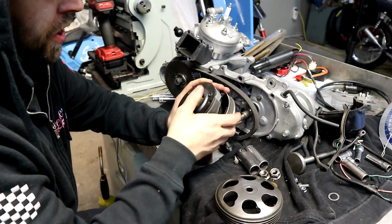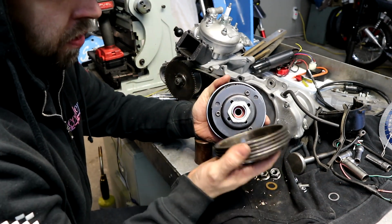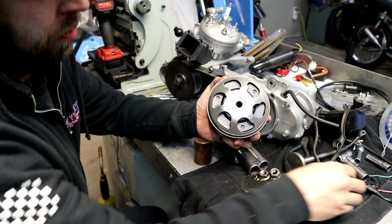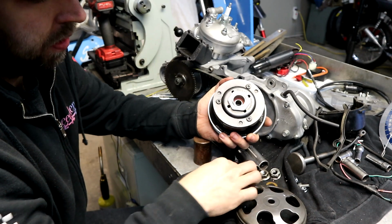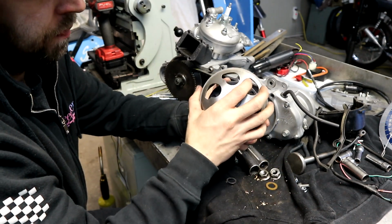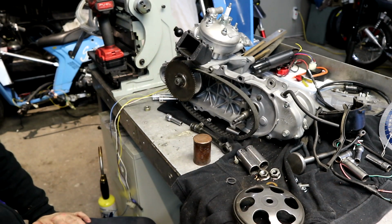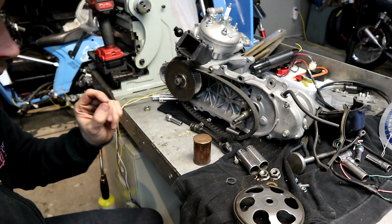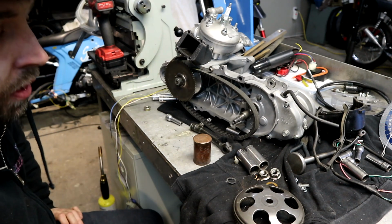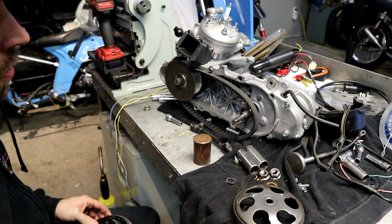And then the last thing you want to check is, depending on which clutch you use, you may end up with interference between it and the clutch bell itself. This one, there's quite a bit of room. You may have to shim the bell a little bit by putting shims just on the shaft to space the clutch out. I can show you on the Stage6 RT motor, the distance between the bell and the clutch is almost 0, so it had to be shimmed out once I put the flat plate mod on it, just so that it would work.